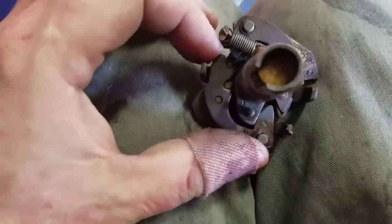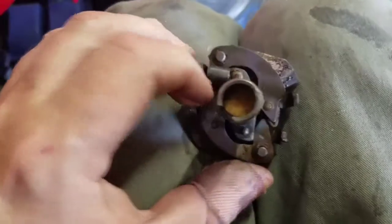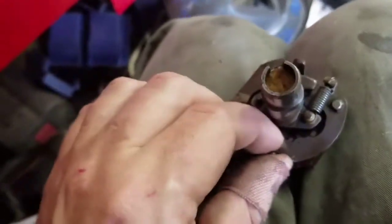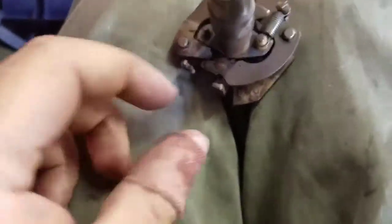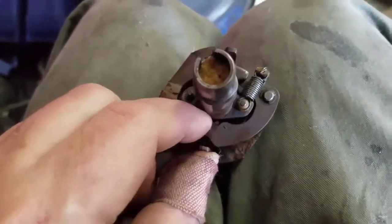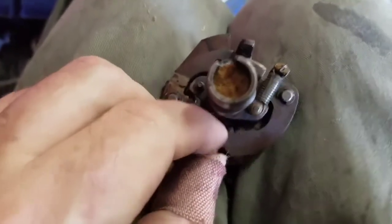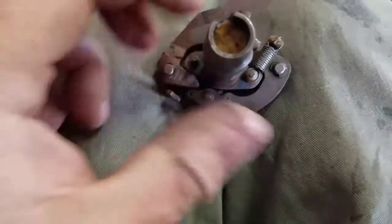On the bottom there's a plastic piece with guides on it. Without the spring, one weight comes in first and faster; then as the engine climbs in RPMs it overcomes the spring tension and the second weight extends. So the advance range might end up at only 16 degrees total — not good enough. Your first impression would be to bend those limiters or grind the body so the pegs can go farther, but that's more work than needed.